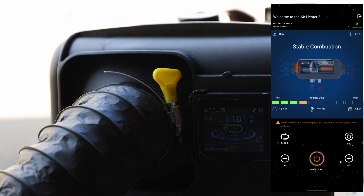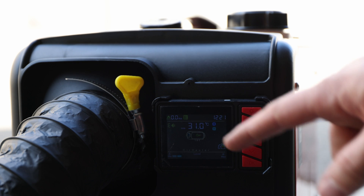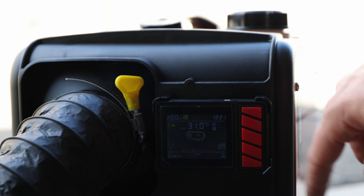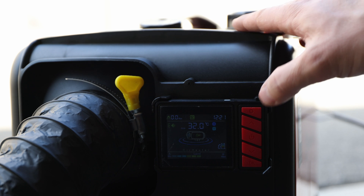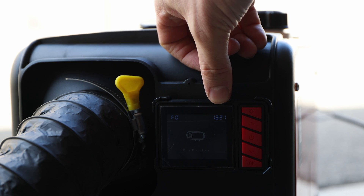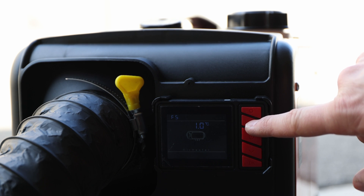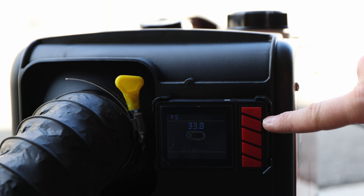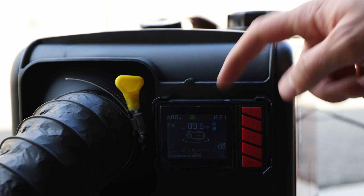I'll let it run and also change from Celsius to Fahrenheit. You click the settings wheel and press and hold for 4 seconds. F0 applies to the time, then F1 through F5 — F5 is Celsius. Hit confirm with the settings button. Now C is blinking, change it with up or down, then confirm. Now hit on/off to go all the way back. Now it shows Fahrenheit.